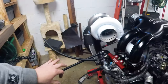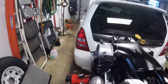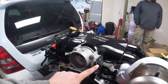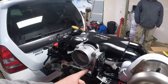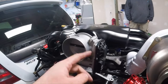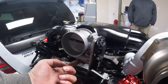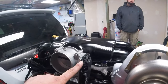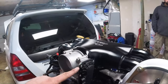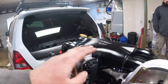We just went to get some rivets. This is the IAG big bore throttle body — they don't come with a cover because you have to swap the motor that sits down here and the tan-colored gear. There's a wave washer that sits underneath. This is a 5/32 rivet to hold the cover on — they're supposed to come with them but mine didn't include them.